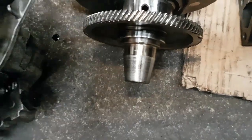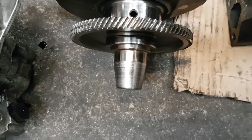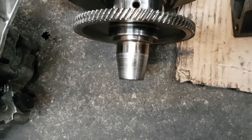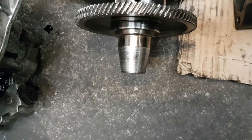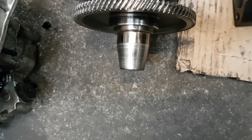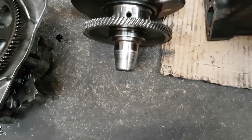When those gears heat up, there's a little bit of what's called backlash between each gear, which allows for a little bit of clearance. That gear is what we call shrunk onto the shaft — it's heated up, pressed on, and allowed to cool naturally — so it stays in one place.